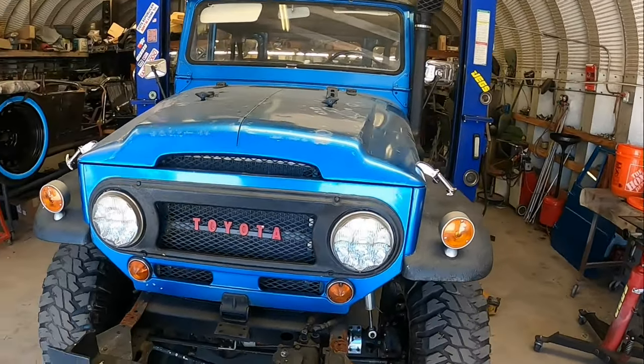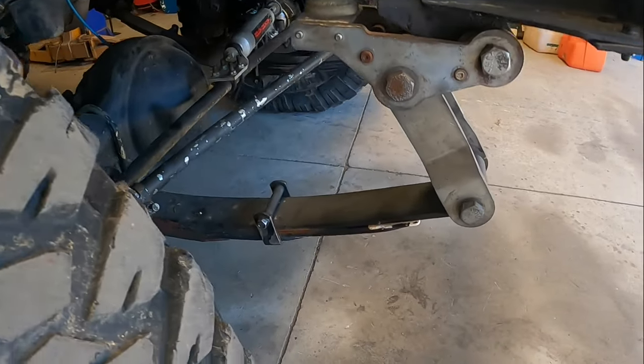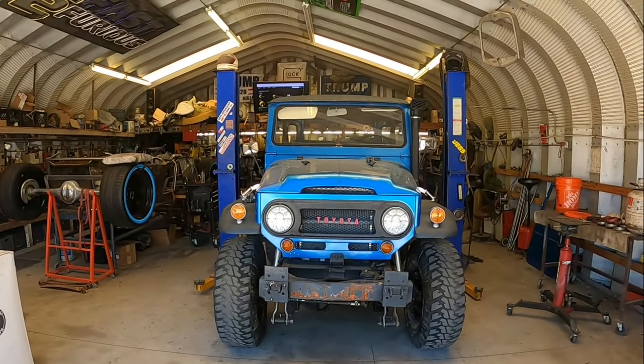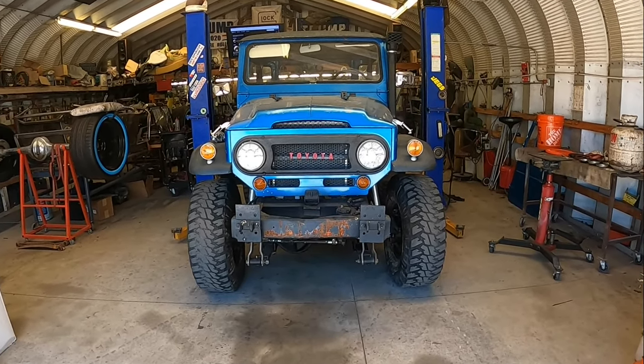So this thing needs a bunch of stuff done to it. I just picked up all the new poly bushings for the leaf springs. I'm gonna try and use these shackles - I was telling the guy that owns the truck that they're probably gonna take these little extendo shackles off, but if I just make the correct stops for them they'll probably work fine. Just gotta make them work properly, replace the bolts. I'm also gonna take the leaf springs out and set them on top of each other because the thing's still sitting crooked a little bit and it's not completely flat.